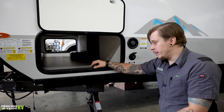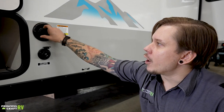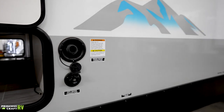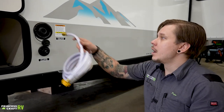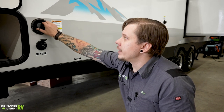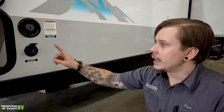Next up are our water sources. First is non-pressurized or potable water — we use this fitting to fill the onboard water tank. Take your fresh water drinking hose, insert it into the orifice, fill up until satisfied, then cap it off. This is non-pressurized water; the manufacturer has included a 12-volt water pump to pressurize that system, drawing water up from the tank to the fixtures.